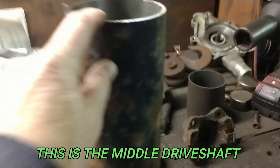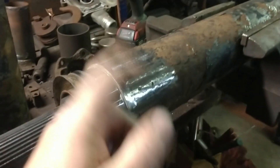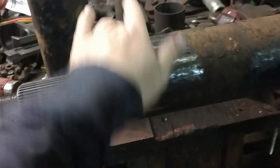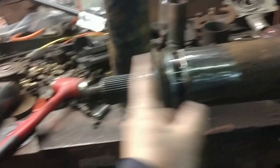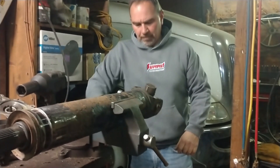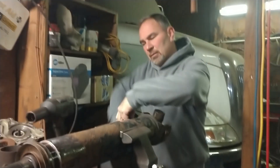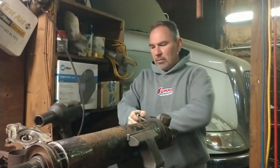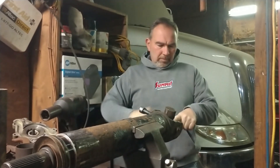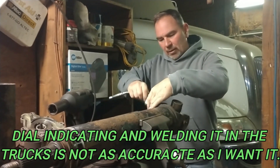There's my 13 inches we took out — that's some fairly thick wall there. It's a nice heavy wall tube so it worked out really well with the cutting wheel. I took a flat disc just to the inside of this edge just to smooth it out, tapped it in just a little bit, and cleaned up around here. I've got it tacked in just to get an idea so I could remeasure with the yoke we're going to use. I've also located new U-joints — this is an SPL 140 on one end and 1710 on the other — so we're going to take these U-joints out and take it to the machine shop to have them weld this on; I can't get it into that little fixture, it's just too small.